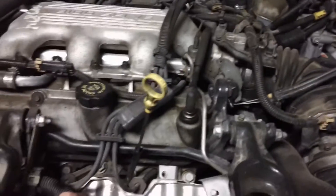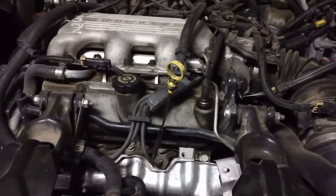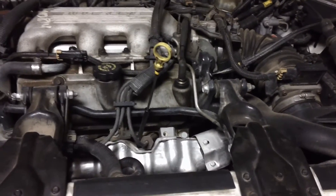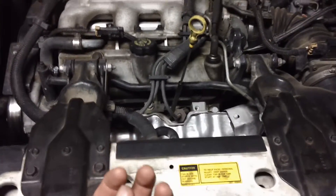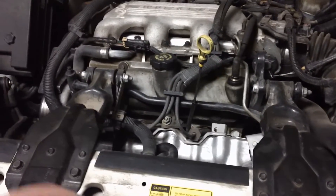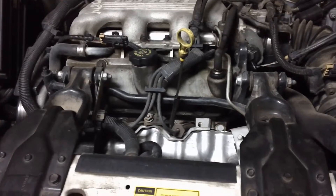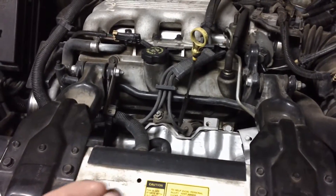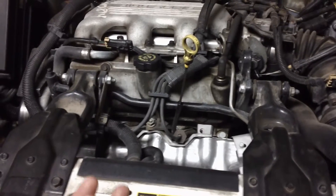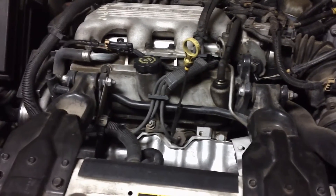The first one I replaced was the oil pressure sensor. It was very easy to tell the sensor was broken — I took the harness off and discovered the inside, where it should be dry, was full of oil. This tells you the sensor itself has broken. It's pretty common because metal parts mesh with plastic parts inside the sensor, and they expand at different rates when the temperature changes quickly.